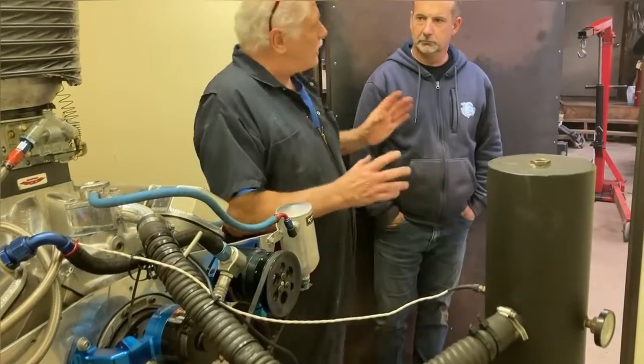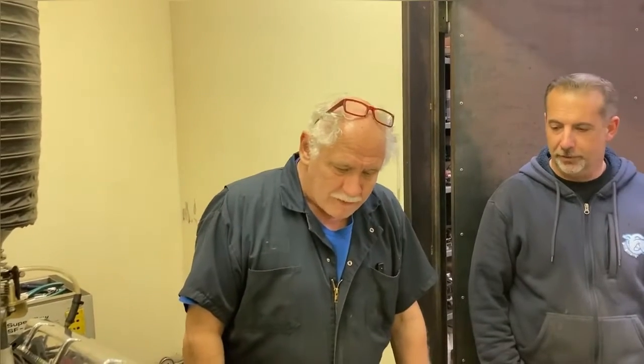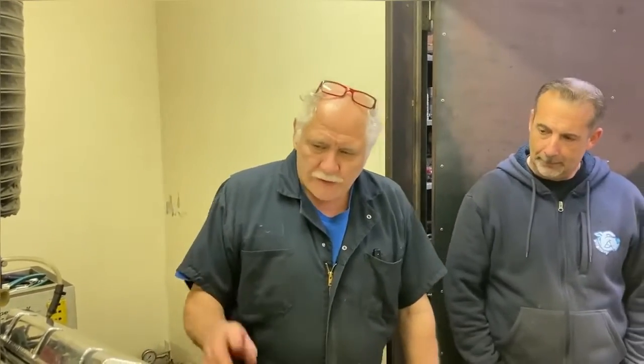Now, we don't really know if somebody really checked top dead center before, right? Is that top dead center accurate? We don't know this. Throwing darts at a board. But anyway, we'll end up with whatever it says is what you're going to run it at. So we do this next one, see if it made more or less power. If it made less, then maybe we drop it back, and then we mess with the cam timing a little. We're going to move the cam timing a couple degrees and see if that does it.